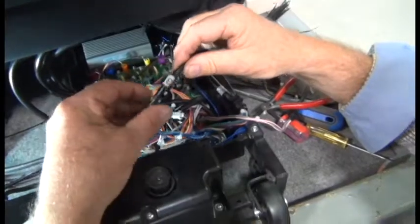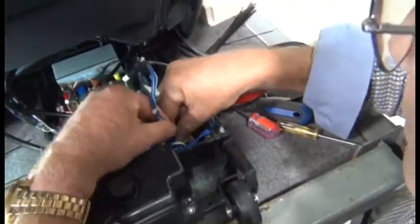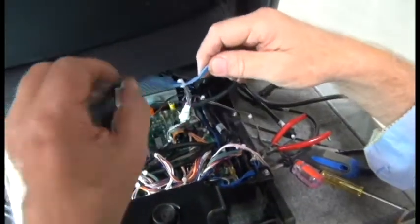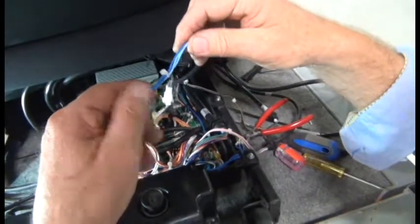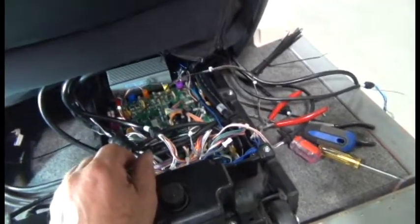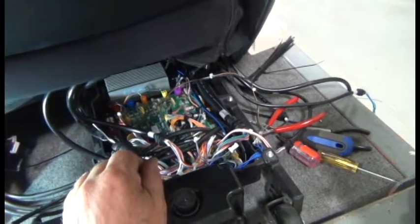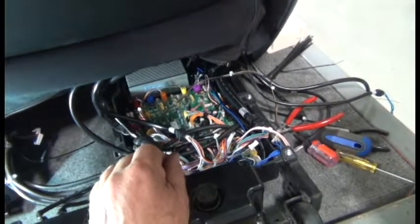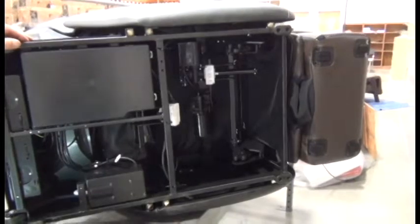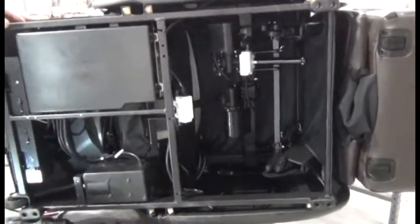And next is number 3, which connects right in the front there. No need to disconnect and cut any zip ties. And disconnect that connector. And cable 3 and all the backrest cables are free from the chair. To remove the actuator, we're going to tip the chair onto its left-hand side, which will give us easy access to the actuator.